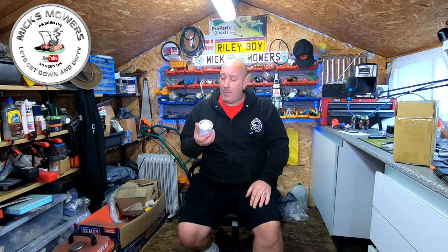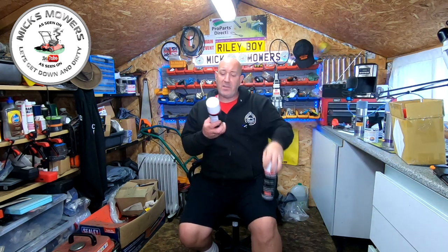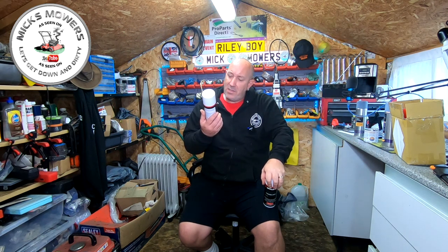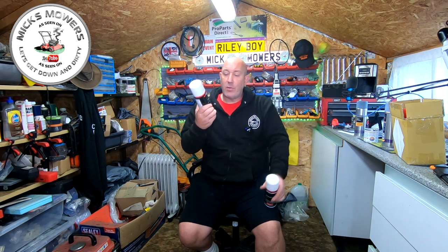The paint I'm going to be using for the silver is just a smooth Hammerite silver paint. But first I'm going to be covering that with an etched primer because it's excellent for adhesion towards metal surfaces including alloys and zincs. I've got two tins of that, mainly just for where the Hammerite's going on. For the green I've got some Ransom's Green, part number 05884 from Spaulding's. If you look up Spaulding's spray paints and punch in the part number 05884, that will lead you towards the Ransom Green colour.